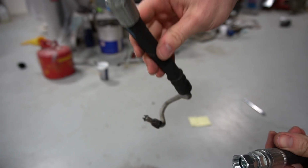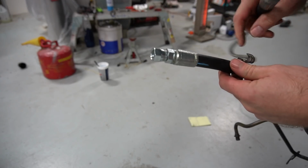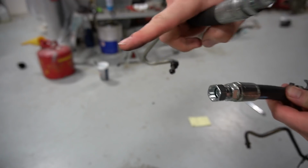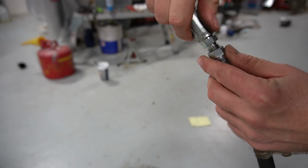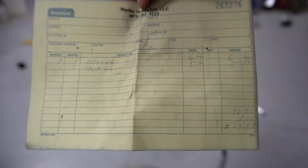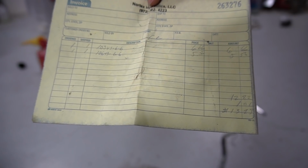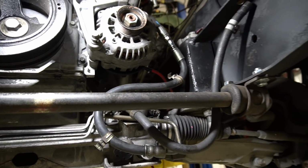So here's the original F-body hose, and then here's that Crown Vic front steering hose, and you can see where it's cut off right before it went into that hard metal line, which made a 90 and a 90 and went after that sensor and stuff. Anyway, looks like this should fit on the truck just fine. And the coolest part was, to have all that done, he only charged me $13.23 to put that line together. So simply a good solution here, and cheap, easy replacement. It didn't take him 5 minutes to make the line or to put those two couplings on that line and give it back to me. So if it were to leak in the future, if I have to replace it or something, it should be no big deal. Looks like this hose should work out really well for me.